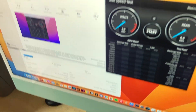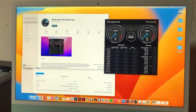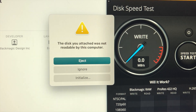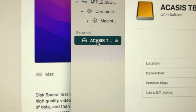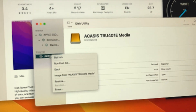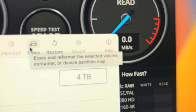We've got the external drive put together. We're going to connect it to my new iMac and then do a speed test. Connecting now — this is the first time I've loaded it, so it needs to be initialized. You'll go to 'Initialize,' which pulls up Disk Utility. In Disk Utility, go to 'Show All Devices' and select the enclosure, then click 'Erase' to format the drive.